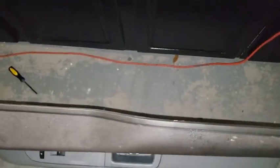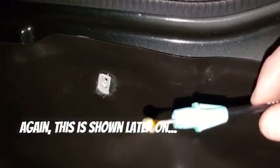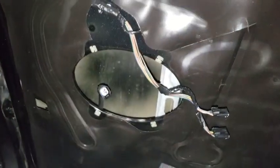To get it off you just lift it up and out a little bit, then lean it forward and disconnect the door handle piece. For the door latch cable I used needle nose pliers to pinch the clips together and slide the clip back, then the cable just slides off your door handle. Then I had two plugs to undo — one's the window, one's the door lock — and then of course your speaker plug. Unplug that, and then there are four bolts holding the speaker on, all 5.5mm.